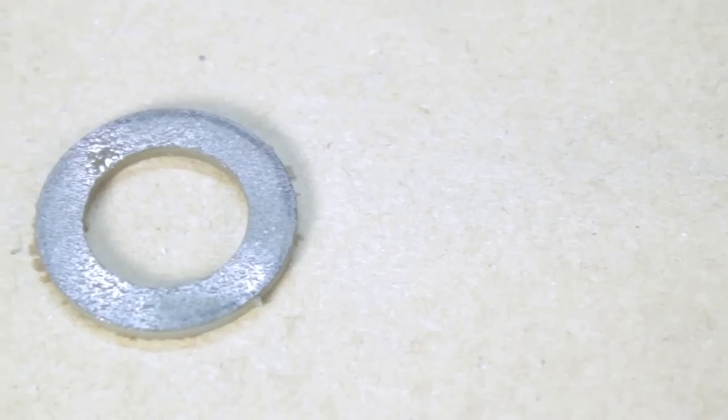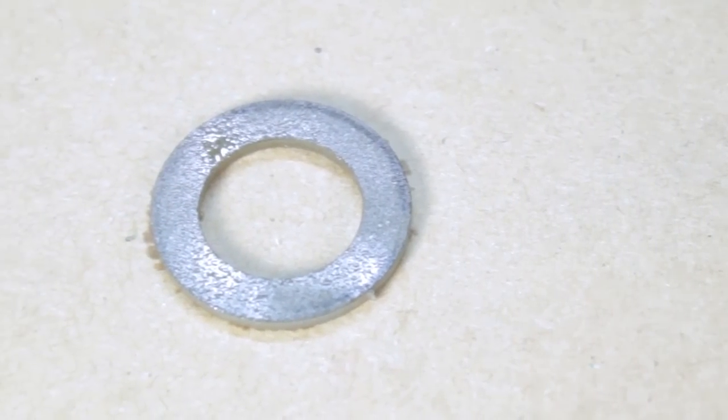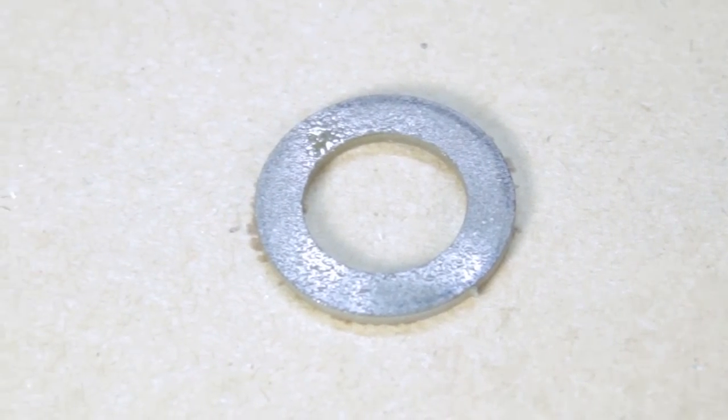The second reason is to prevent washer failure. The supercharger is made with a built-in friction clutch, and as the spring washers lose their holding capacity, the friction clutch begins to slip under normal operation. This induces additional wear and heat into the friction washers, which can cause a catastrophic failure, resulting in the assembly dropping into your engine. Our rebuild replaces these parts and keeps the assembly tight.